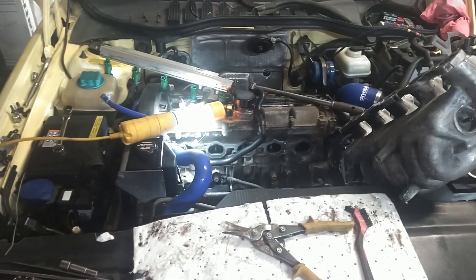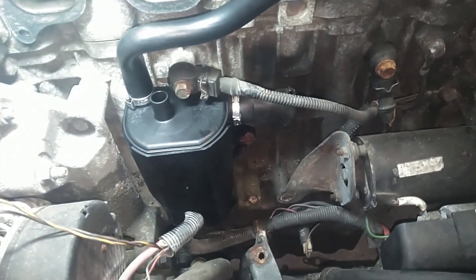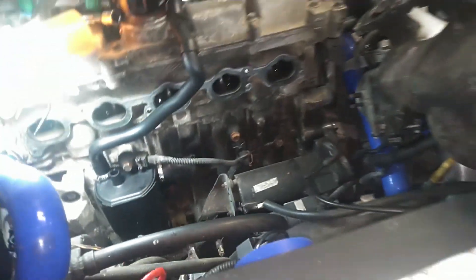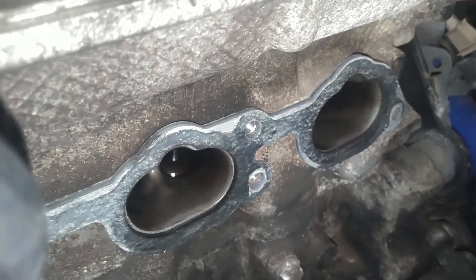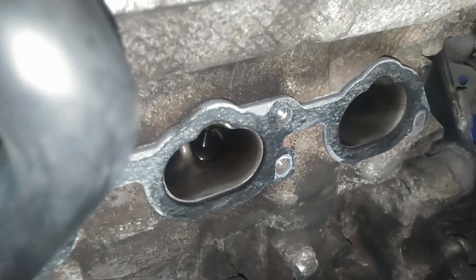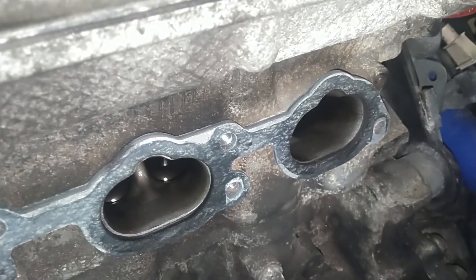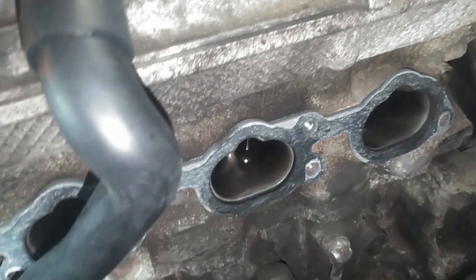Kicking off the morning with the yellow 850 sedan. Finishing up the PCV that we started last night. Removed that bolt on the bottom back of that starter bracket — it has a funny intake manifold spacer heat absorber there. There didn't have a gasket on this side of it; I left it sealed on the engine.